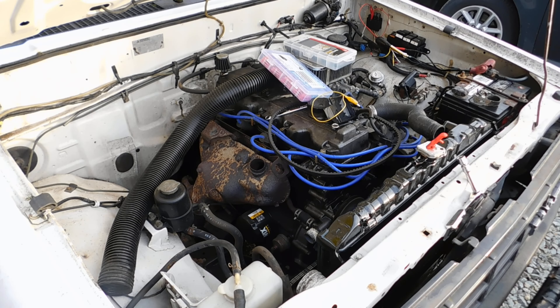It said tension the belt to where it doesn't slip or squeal, then tighten the set point down. I always thought that was funny. Let's see how much stretch this belt has — that's quite a bit, I don't really like that. We're gonna go right there, call that good. That's nice and Subaru spec — I'm sure Mitsubishi has the same spec as Subaru.